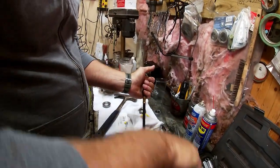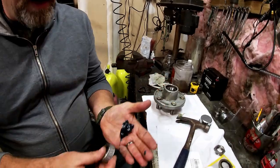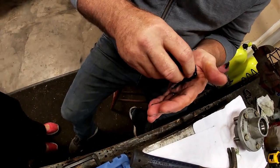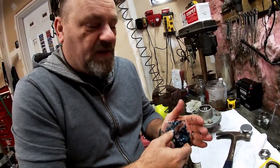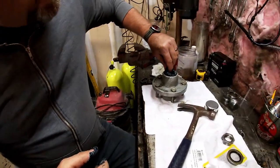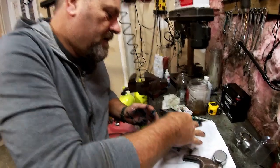This is where we get greasy. We're going to put a big handful of all-purpose wheel bearing grease — use waterproof grease. Take the grease, put it in the palm of your hand and mash your bearing into it. Keep mashing it — pack it right in between all the little bearings. Pack that grease right into the bearing. We're going to try to use as much grease as we can. If somebody's got an easier way of doing this I'd like to see it, because this is messy work. Put gloves on. That bearing is very well packed — you can see the grease coming out. Sweet. Greasier the better, gooeyer the better, I always say.